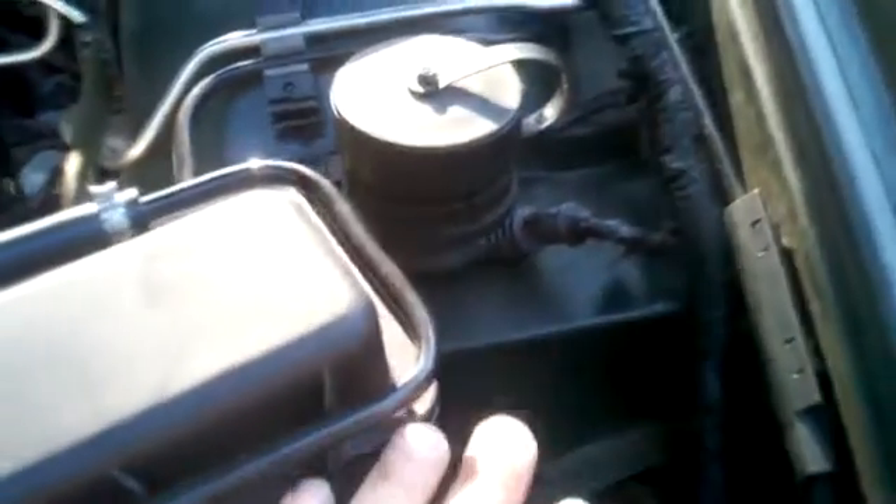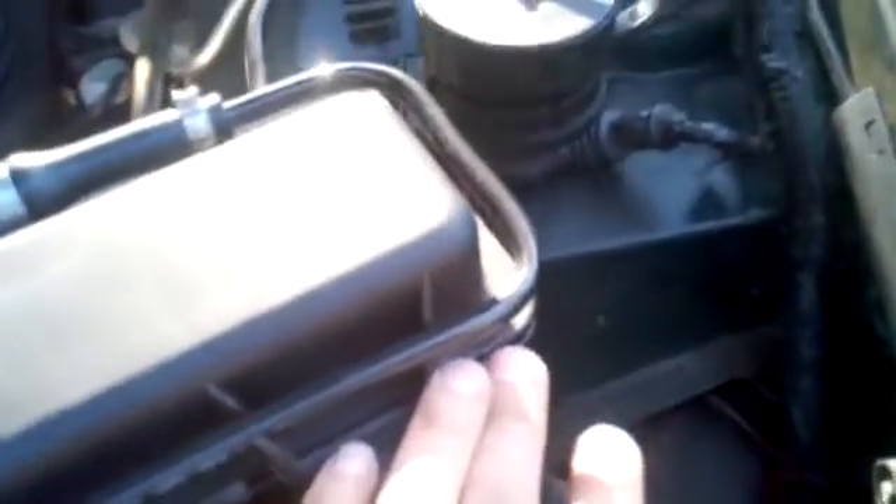You'll be good to go after water pump replacement, radiator, or replacing this expansion tank itself. This one looks like it has a new line — probably a replacement expansion tank. I've seen where the seam actually separates and you'll see white residue or spray; a lot of times it only starts spraying when the vehicle is under pressure and you won't notice it until you actually feel it. That is a relatively common failure. I've also seen radiator upper hoses crack, which is coming on a lot of BMWs unfortunately.